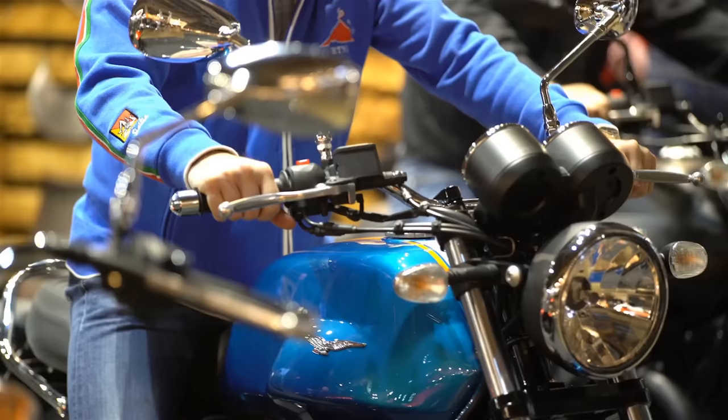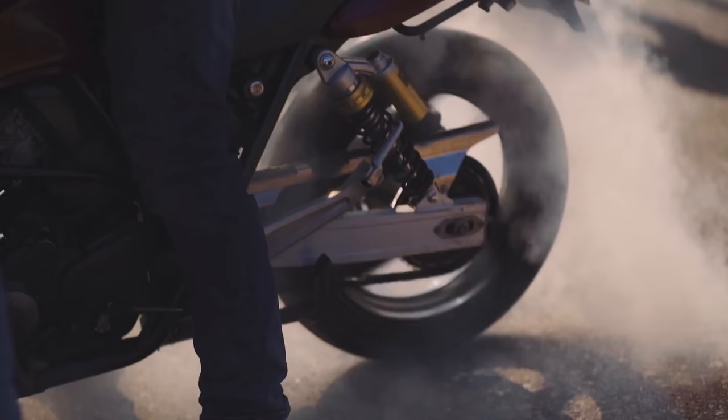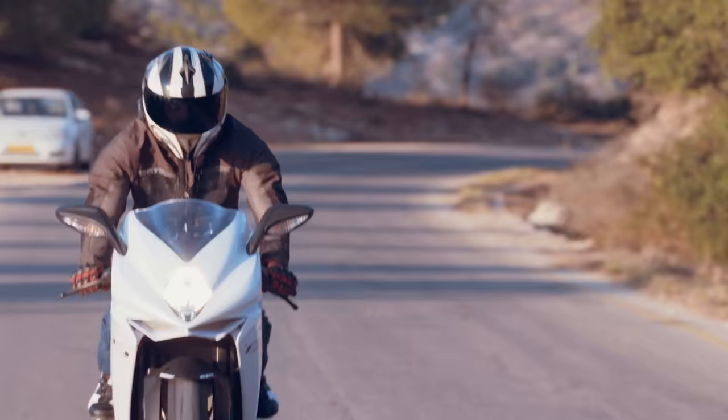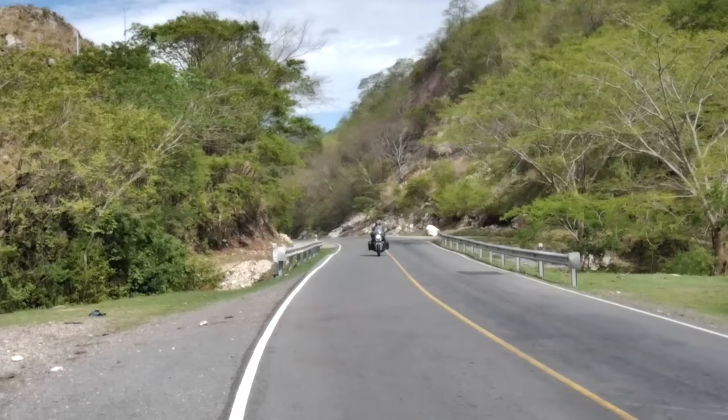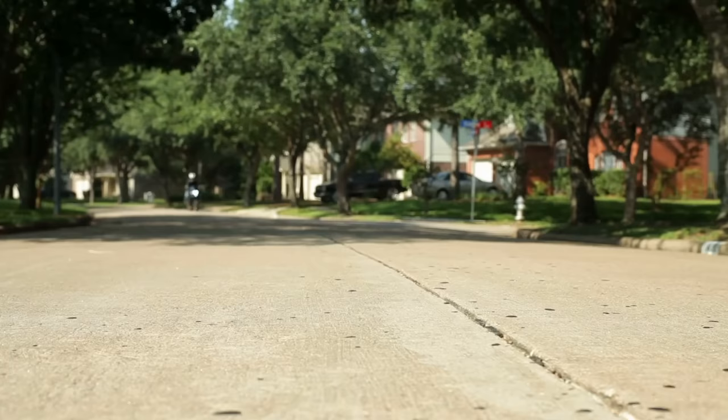Here's how I would go about buying a brand new motorcycle and driving it off the lot. After the deal is done and the keys are in hand, I would first start up the bike, let it idle for 5 to 10 minutes, and make sure everything appears to be in proper order. Then, when first leaving the lot, take the opportunity to break in both the tires and brakes with some gentle acceleration, progressive braking, and turning to tear off some of the manufacturer's sheen on the tires. After that, I would begin riding somewhat normally on surface streets. It's best to avoid a highway so you don't risk staying at one constant engine speed for too long.